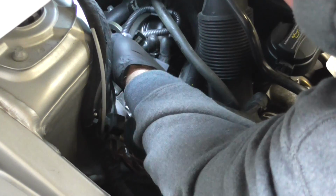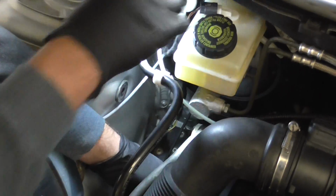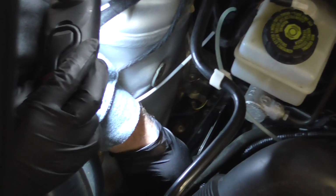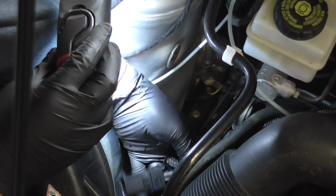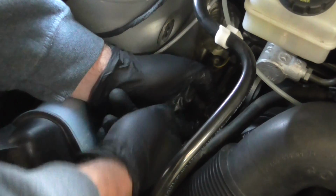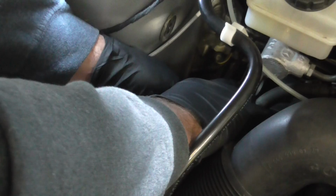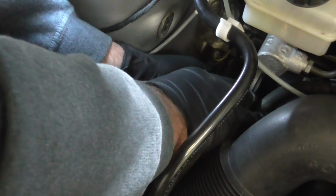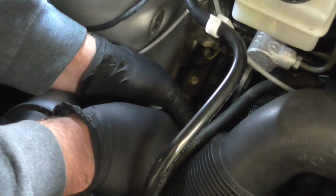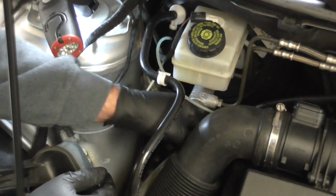So now we've got the Turbotune wiring harness. We'll click one end of it into the fuel rail. You see it going in there, and you'll hear it click home. Push this all the way home and then push in your lock and tab and just give a nice pull on the connector to make sure that it's nice and tight.